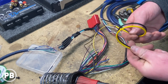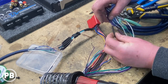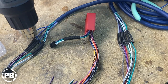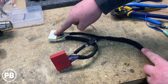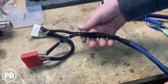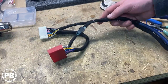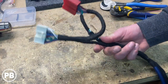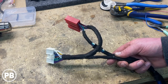We extended our power and ground, which will run along with this to power our LC7i. We put heat shrink over all connections and shrunk it down. Here's our finished harness — this is why we love these T-harnesses. One end plugs into the radio, the other plugs into the harness that originally was in the radio. All the pass-through wires are there, power and ground are hooked into our input and output cables, and the whole length runs to the amplifier and LC7i at the other end. Simple, easy, plug-and-play.